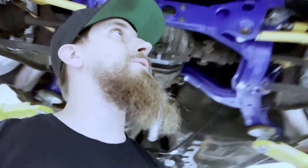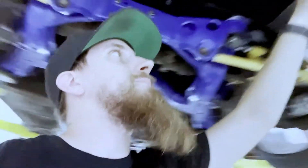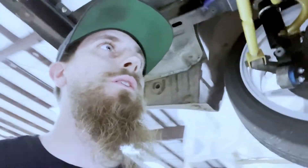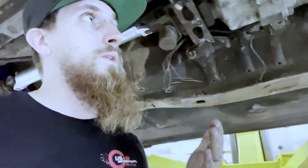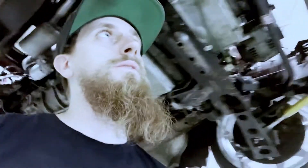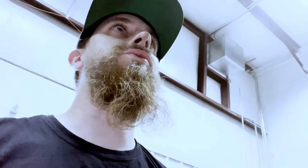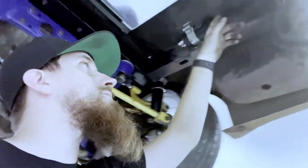Ran into a little problem with fuel. The fuel pump — it's all metric, so I got 18 by 1.5, and then 12 by whatever on the feed side. So I got to make the decision if I want to just buy a new pump, or I already bought two different fittings — I don't know, I'm just spending money on stupid stuff right now. Just buy a whole bunch more fittings — some more 90s — coming off of the fuel tank to the filter regulator to the pump, and figure out where we're going to run the line from there.